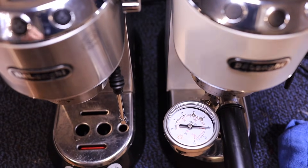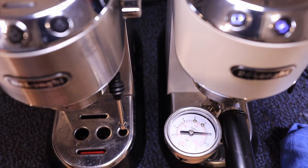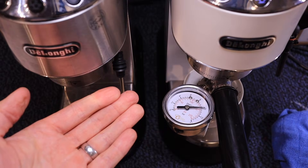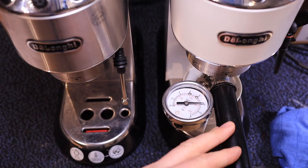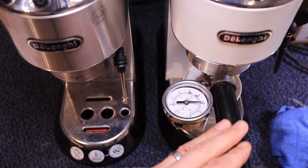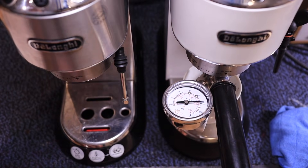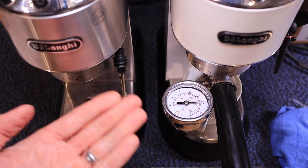Based on my perspective, this tops out at 11 bars. Now, with this DeLonghi machine there's nowhere for the pressure to go, so take caution if you try this at home. You can see it's still under a lot of pressure — it's still got 10 bars and that takes a very long time to eventually dissipate. If we had a filter in here instead of the pressure gauge, the pressure would eventually be released through the filter, but that's not the case.